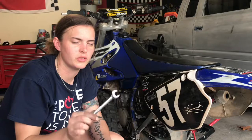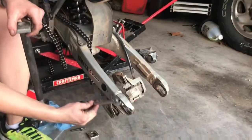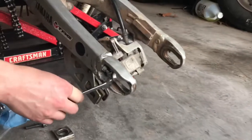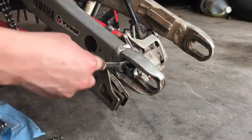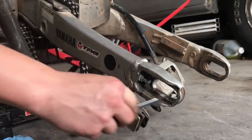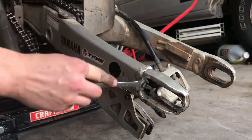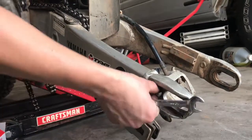For the locking nuts, it's a 12mm. To get it past that little section I was telling you about, you're probably going to have to use a wrench. You're less likely to strip it when you're moving it — once you take it off, if all this is off right here, just move it upwards instead of fighting in between here and getting the wrench stuck. Just move it out so you're less likely to strip it.